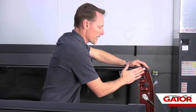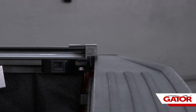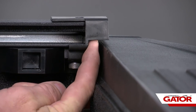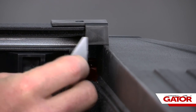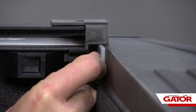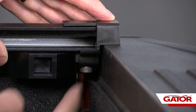Next we're going to make sure we align the rails to the tailgate. We're going to close the tailgate, but before we do that, we're going to slide the rails forward on both sides so they're all the way up against the bulkhead, so we can close the tailgate nice and gentle and make sure we do not strike the rails with the tailgate. We need to make sure on both sides that the edge of the end cap is one eighth of an inch away from the tailgate. Use an eighth inch spacer — slide it in between the tailgate and the end cap, slide the end cap to where it hits that spacer, pull the spacer out and do that on the opposite side. Now you've got a perfect eighth inch gap.